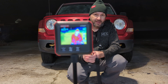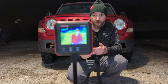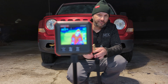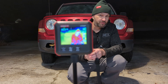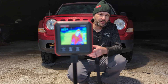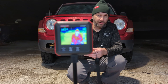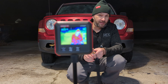If you want to see my full review on these Auto One LED headlights, that'll be linked up here. For a short summary: manufacturing quality on them is excellent. They do require those decoder things to plug in to keep the car from flashing and flickering them — at least for a Jeep Patriot. That may not be true of all vehicles but I expect it's probably true of most Chrysler, Jeep, FCA, and Mitsubishi vehicles from that era since they all use pretty much the same electrical system. They do produce a lot of very pretty white light in clear weather conditions and work really well, but just like all other LEDs they struggle with rainy and wet conditions.